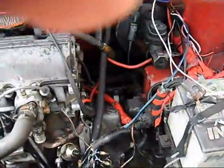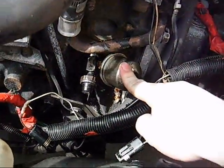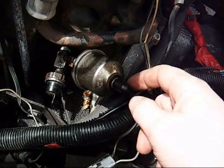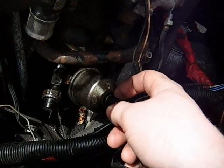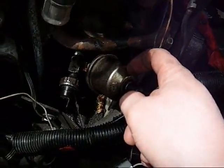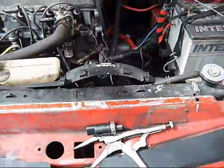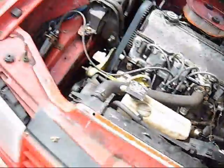The other wire was the oil pressure sender. I grabbed the oil pressure sender out of the junkyard from any older Dodge that has an oil pressure gauge - basically anything from the early '80s up to maybe '95. I think I pulled this one out of a Dodge Dynasty. The stock setup for Shadows is just an oil pressure switch for the warning light. Some of them have a sender built in, but I've always just used the old style and it's worked well.